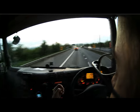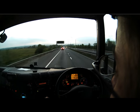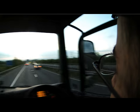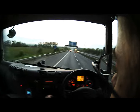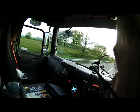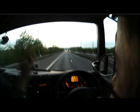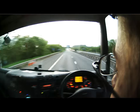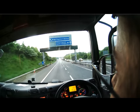There's not much happened, the truck just carried on. Yeah, at first I thought it had just driven through a pothole or something. So it was that sort of louder bang and the truck didn't really react in any way. Then I remembered the blowout that I saw on the low loader and I thought, well, it could be, yeah. Looked in that mirror, nothing. Looked in this mirror, massive cloud of dust and everything, classic signs of a blowout. And then smoke and stuff coming out from underneath the old wheel arch where the tyre's rubbing against the ground, burning rubber.